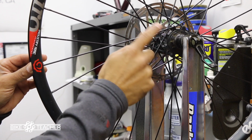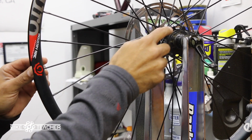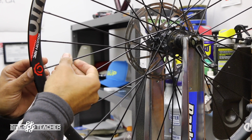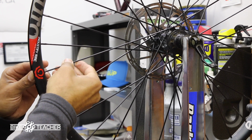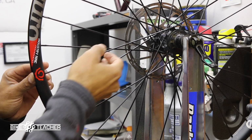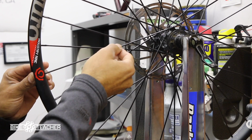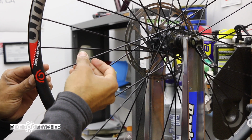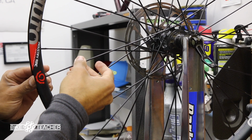Now we got an aluminum hub, an aluminum spoke. I'm going to make sure that these threads do not get stripped, so we're being very gentle when we start to turn. They should be in a nice straight alignment, but we just want to give this a few turns, see if it catches. I'm going to give it a pull back. And it's not coming back, so that tells me that the threads got started nicely. I'm going to see how far I can go by finger.